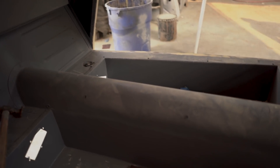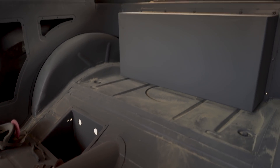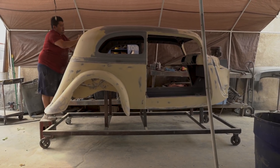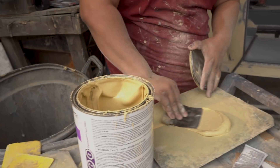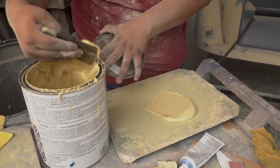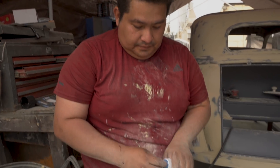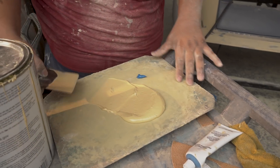So just a tiny little bit of bodywork modifications that you're noticing you're going to do — not much. We've already had a few that we ran into and had to change a little bit. There was a couple of areas inside the passenger door jam we had to pull out, cut, and weld up to make a little straighter. Also a couple of things on the firewall that we welded up, finished welding, cleaned up, metalworked, and filled.